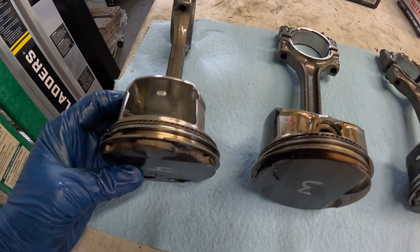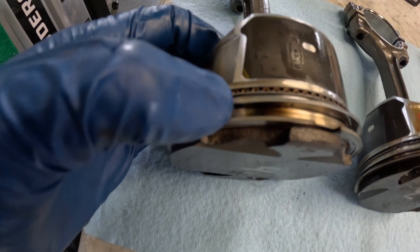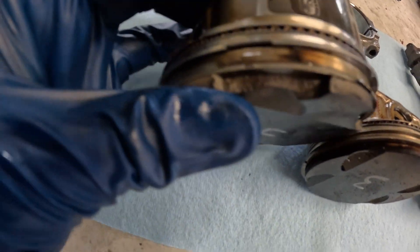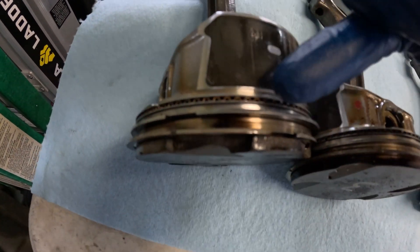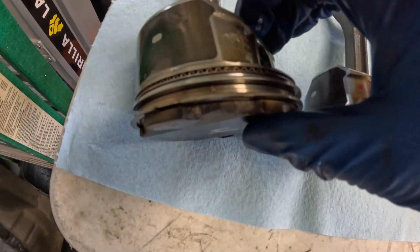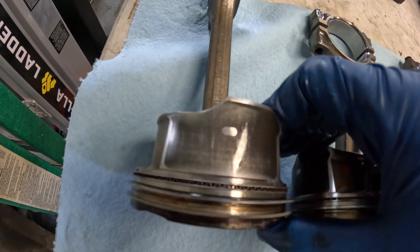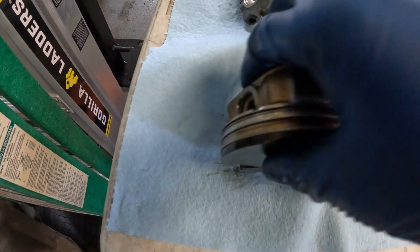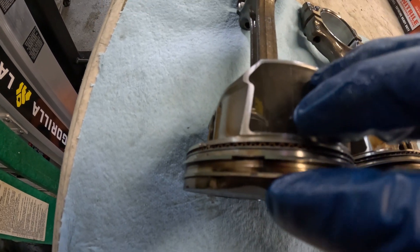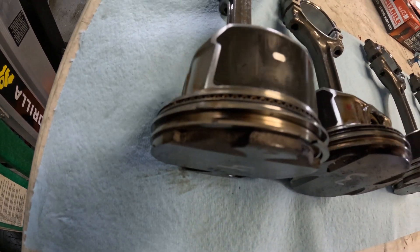Now let's look at the skirts. This is the intake side on number four. If you look in this ringland area between the third and second ring and the first and the second ring, we do have a crack. It does look like there was some type of detonation taking place — there was an explosion right there. You can definitely see the color. That's cracked all the way down to the second. We got a crack on the other side as well. The rings themselves actually look pretty good. I don't see a whole lot except maybe a little piece missing — almost looks like a factory indent, just a little tiny indent right there.